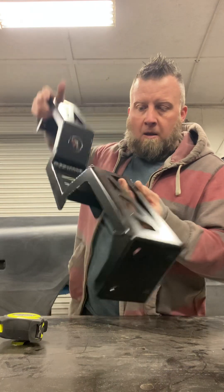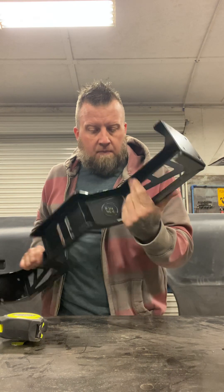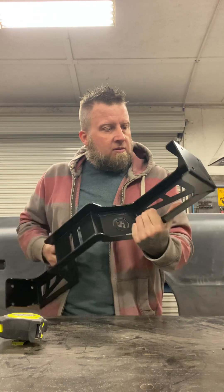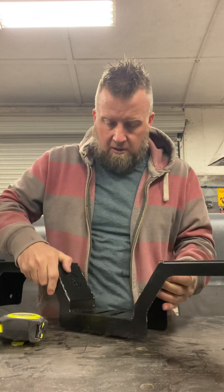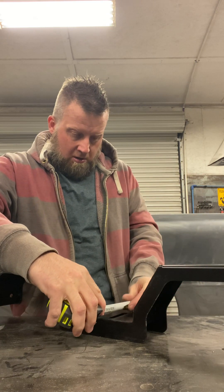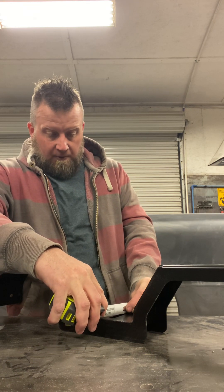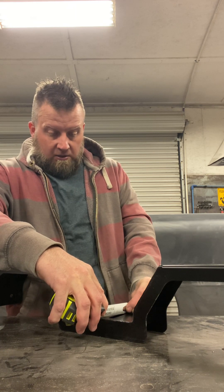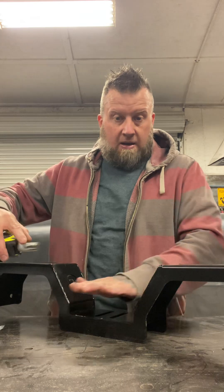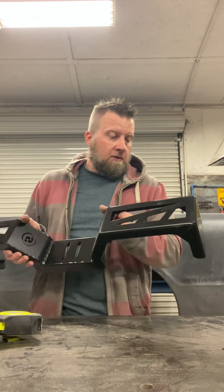Here is actually the transmission mount itself. It's not really heavy, but it's real sturdy. It looks like it's in a couple of pieces. Here are the transmission mount slots — they are 2¾ inches. So you have half of 2 which is 1, and half of ¾ which is ⅜, giving you 1⅜ inches of adjustment. It is also notched out for up to 3-inch exhaust.